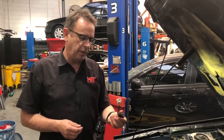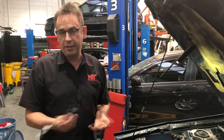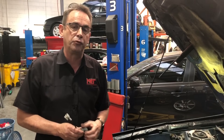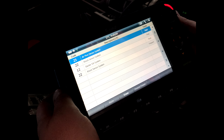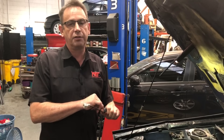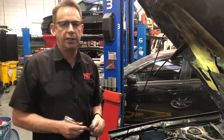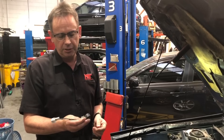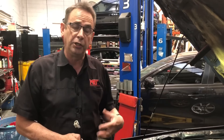In the case of this particular car, there was a fault code on the dash. We'll drop in an image of the scan tool fault code so you can see what I'm talking about. We scanned the ECU and came up with a fault code on the knock sensor. The first thing you typically do is look and see if it's broken, and then check the wiring and connections back to the ECU as well. In this situation it was pretty obvious the knock sensor was faulty, and we've now replaced it with a brand new one.